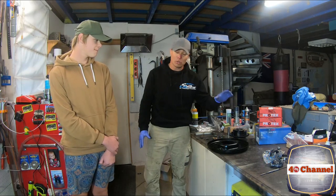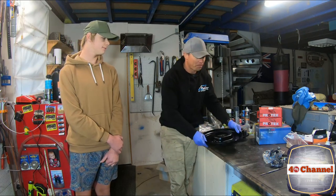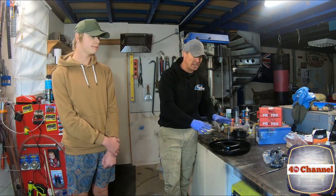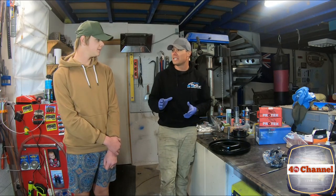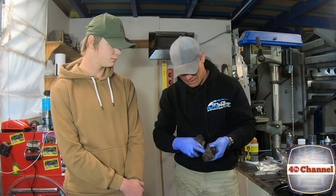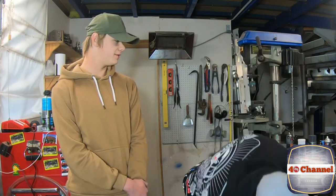Today we're doing our brakes. We've got all new wheel cylinders and all new brakes. I've already ripped them all apart and cleaned them up — it's not difficult, basically eight bolts and a couple of springs. The brake assembly is a little bit different: two wheel cylinders per side, and we actually have a left and a right, so we don't want to get them mixed up. The old ones have L and R stamped on them — and I love the old Toyota logo on everything.